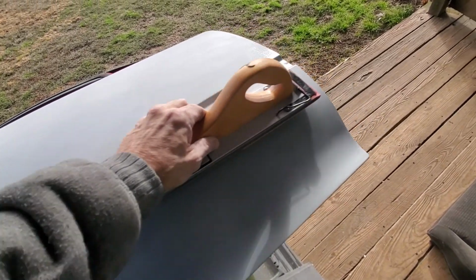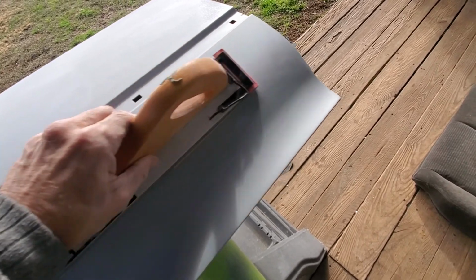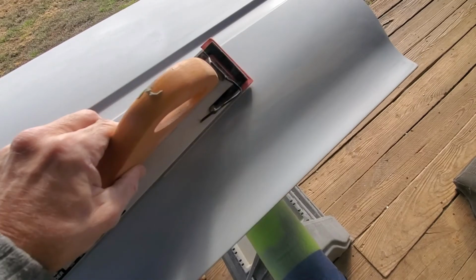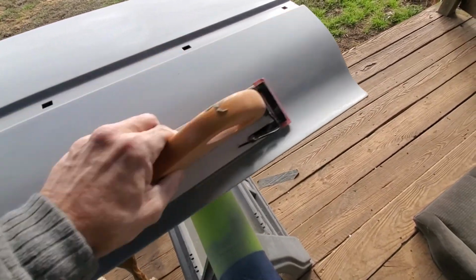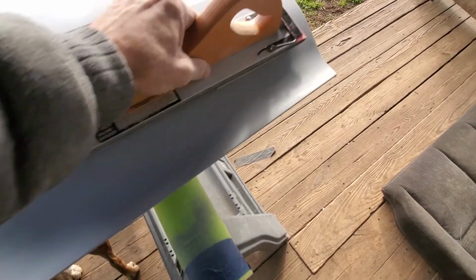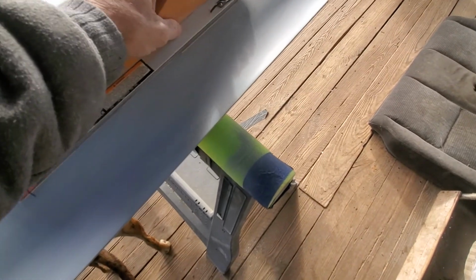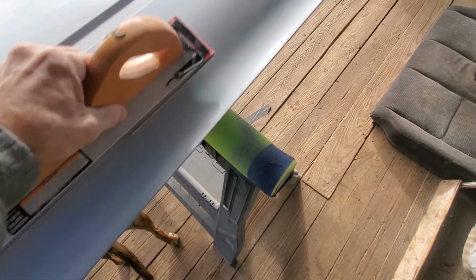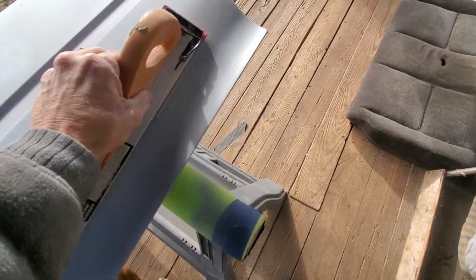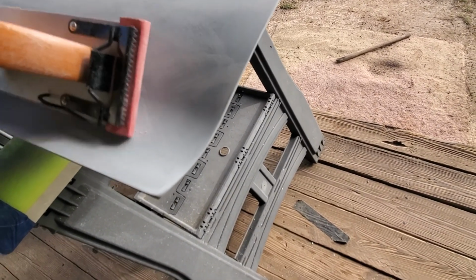And while you're sanding, you don't go back and forth in one spot, because this is all angled. You've got to kind of move it down in, cross like this, down in there. But you've got to keep it moving or you'll make flat spots all over it. I'll just do this for a second to give you an idea. If you guys at home haven't done body work yet, if you stay on an edge like this, on a high spot, or if you stay right here, you'll dig two trenches. You've got to keep it moving all the time. And I'm holding it up on an angle too while I'm getting across and down in there.